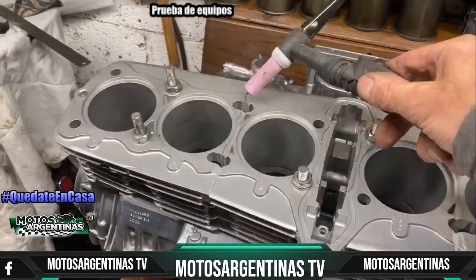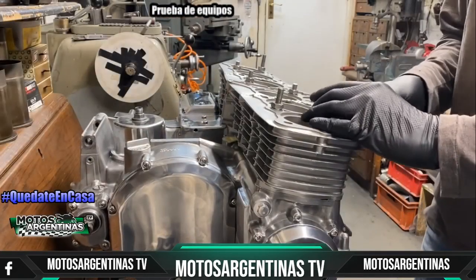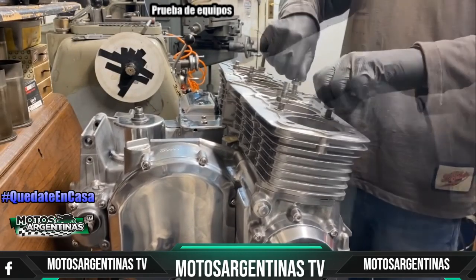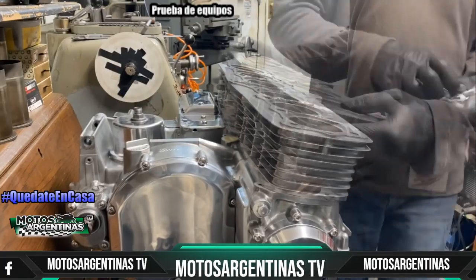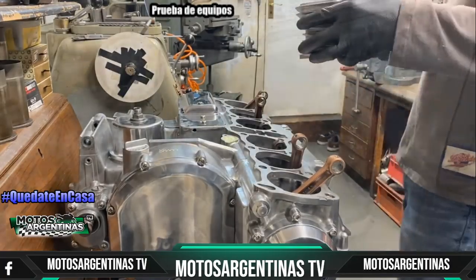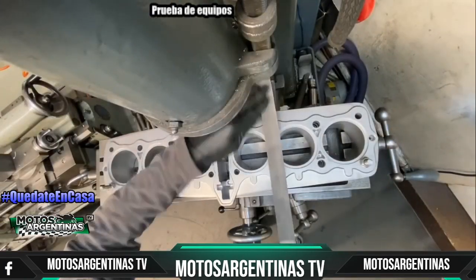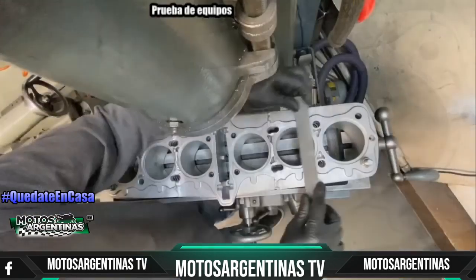With the welded joints complete along the top of the barrels and down the fins where I could reach, I removed the barrels from the engine so I could file flat the welds. I transferred the barrels to my milling machine table and bolted them down secure on the nice flat surface, then proceeded to file very carefully the top surface flat, just removing the weld raised area.